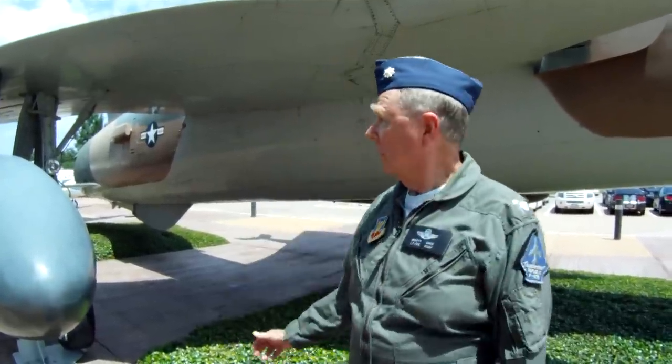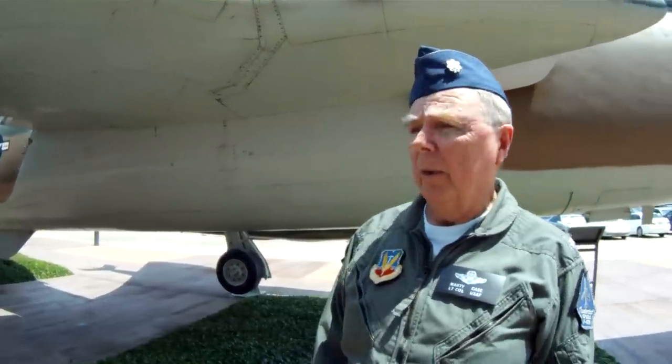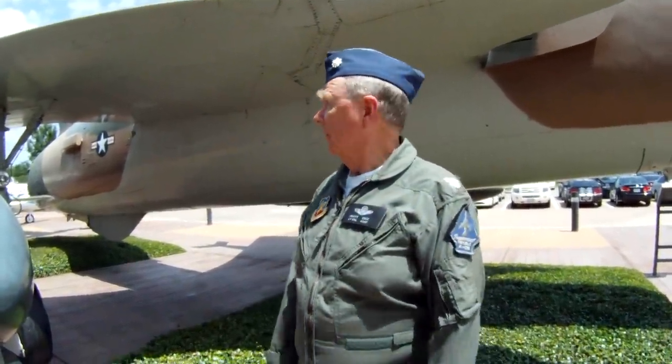As everybody knows, the airplane was designed to go fast. It has a coke-bottle fuselage because Kartveli had trouble getting the airplane to go supersonic. The area rule theory had finally become widely known, so Kartveli used that on this airplane. Normal climb speed was 400 to 0.9 Mach — that was just normal every day. Initial approach was also flown at 400, although the book said 350, but most of the time it was at 400. The airplane just felt better at that airspeed.